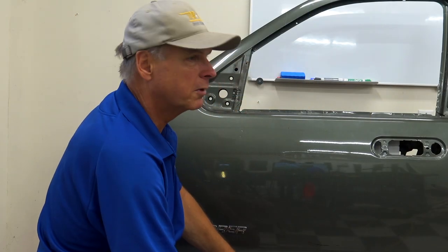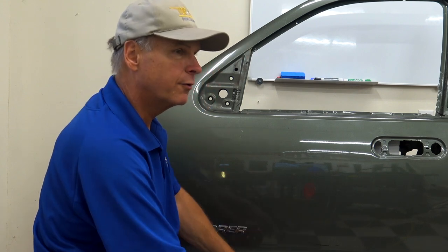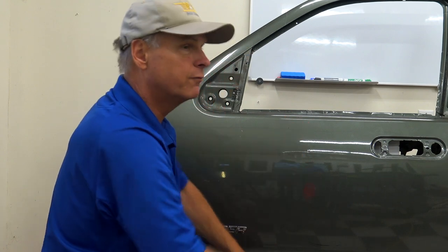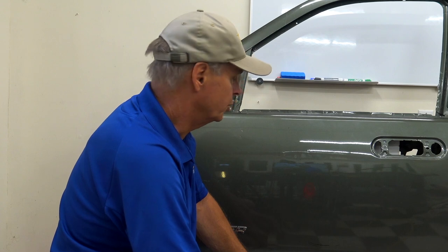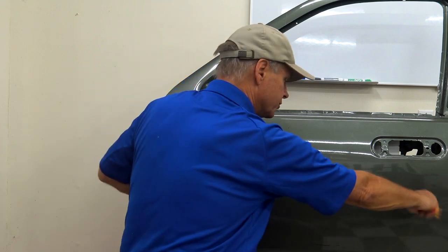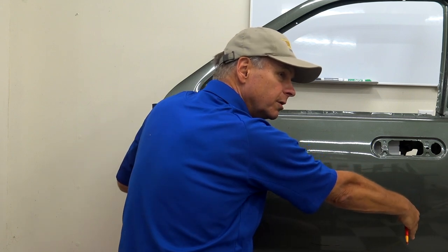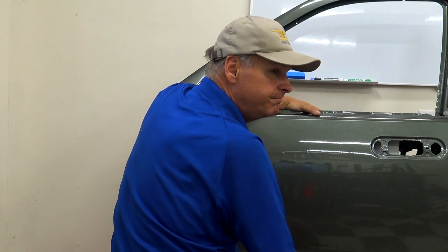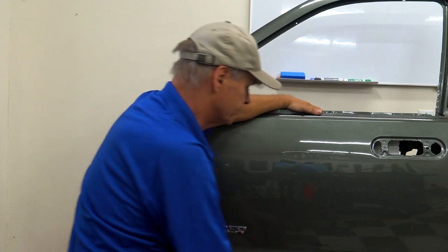When sheet metal is formed at the foundry, as you already saw if you watched that first video, when they roll it out, it's made to be in tension this way and compression that way. That's standard. So before it even goes on the panel, it already had forces built into it. So what happens when a panel is damaged, gets hit, is what should be in tension is now in compression, and what should be in a little bit of compression, the crowns, blew out into tension. That's one of our problems. So it's reversed. Exactly right.